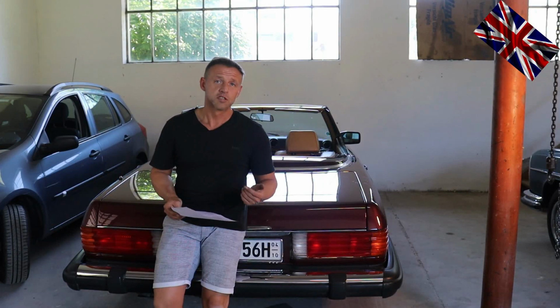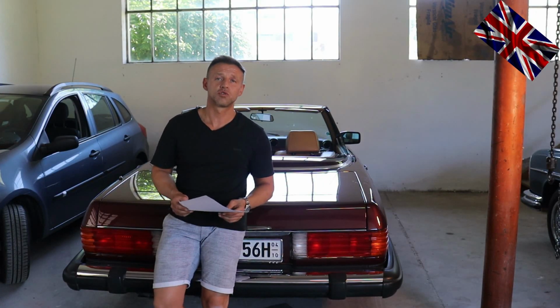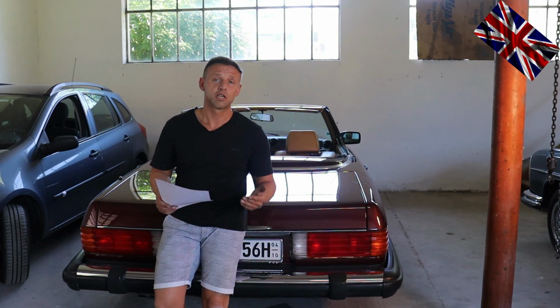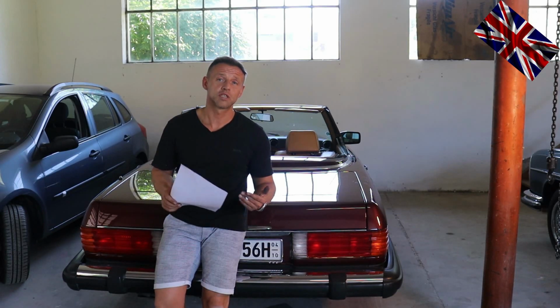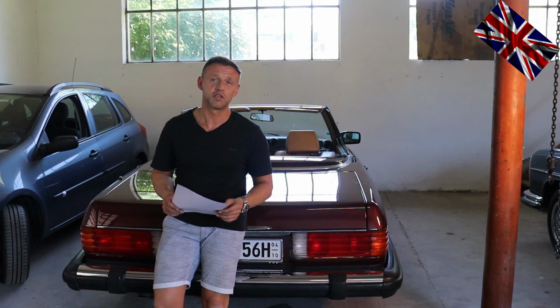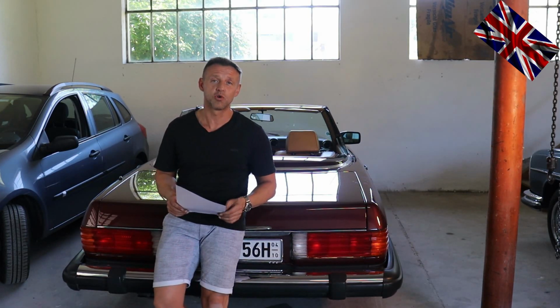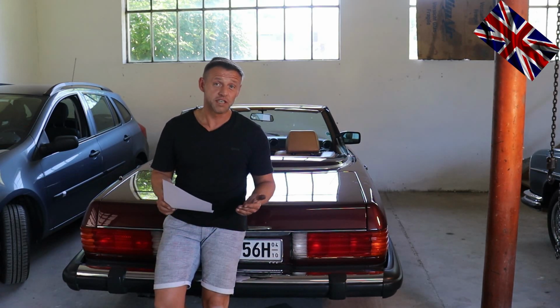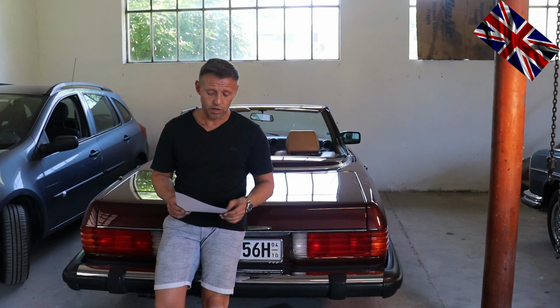So this job was the first one amongst others on my list. All because of a small spring that got unhinged somehow. The notch could not engage to the counter notch to make the stalk slide back to position 0. Olaf does not have to do this manually anymore. Things are back to normal when engaging the turn signal. We will carry on with this very car and some other issues.